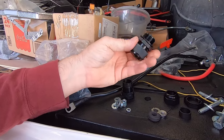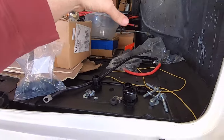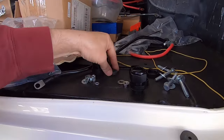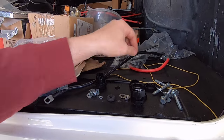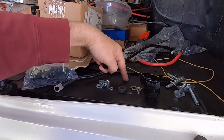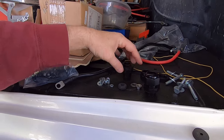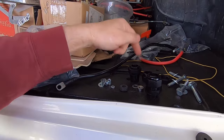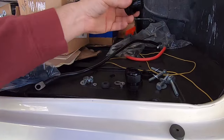They have two nuts on the bottom. You drill a hole in the trunk floor — in this case Steve's putting an old-school ice chest back there with the battery in it. Before I had little rubber grommets on the trunk floor and in the ice chest, but the ice chest is really thin aluminum and I'm afraid it's going to chafe through that grommet and into the positive cable, causing a short. So I'll enlarge the holes in the cooler and the floor to accept these, run the cable through them, put the nut on the bottom, and there's no chance of chafing because it's going through plastic instead of rubber-isolated metal.